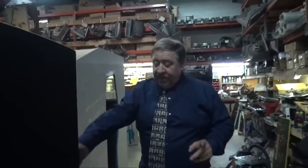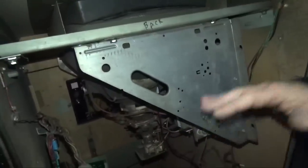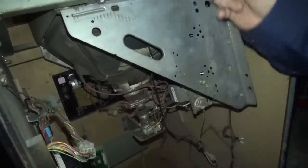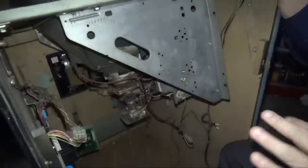When you move these monitors with the power on, so you see, now let me show you why. Do you see how the monitor is hanging down? It's not flat, it's not up. It has something to do with the magnetic fields on the yoke and on the tube. There's magnetic forces at work here because the ground is down there. That's where the bottom is. So if you move a picture tube in this position, you'll get that funky reaction, especially a cocktail table.